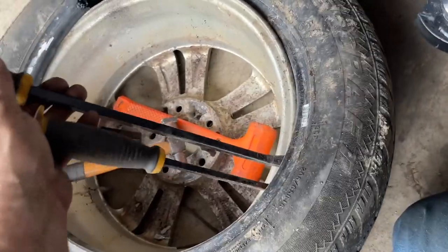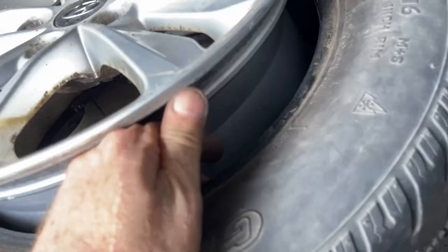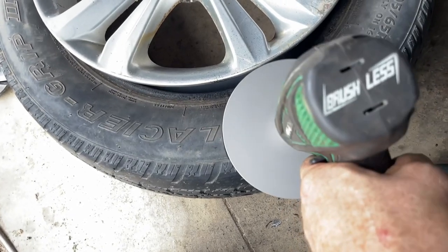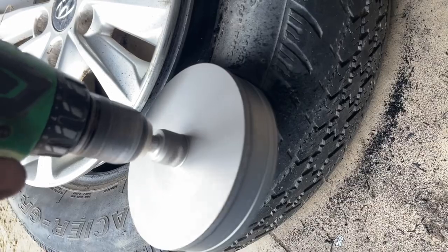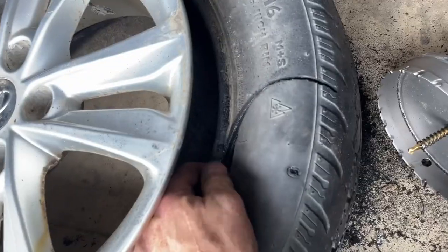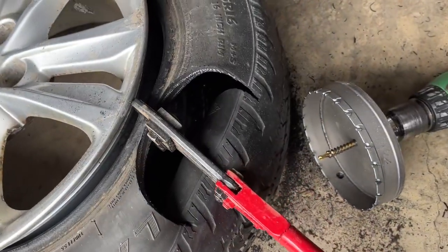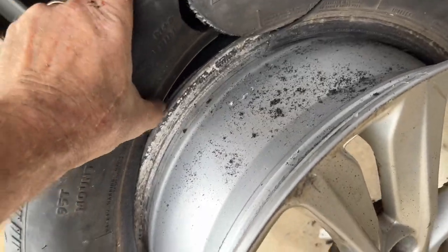As the tension comes off it'll get easier. Pull the entire bead off — this side is complete. We'll remove the other side; there's a lot more room to cut that bead this time. This is a carbide tooth hole saw. Cut the softest part of the tire without any metal in it. On the second side you can see we've got plenty of room to cut the bead and get the cutters all the way to the very end. See those wires and the bead that we need to cut. Push the bead to the other side to free the rim.